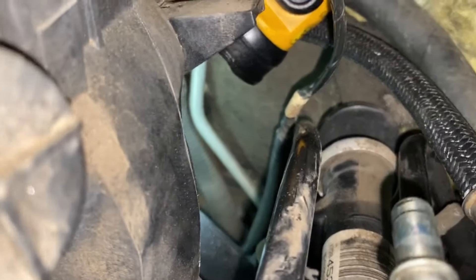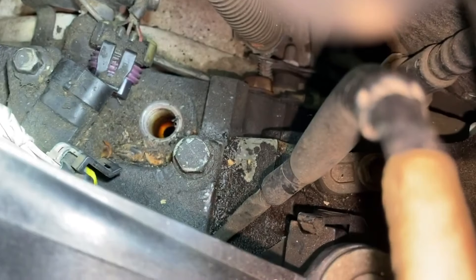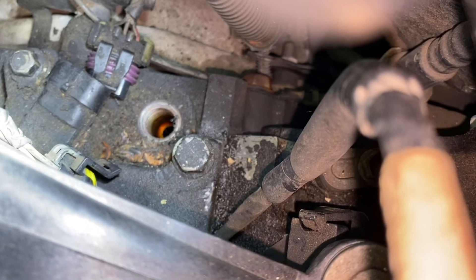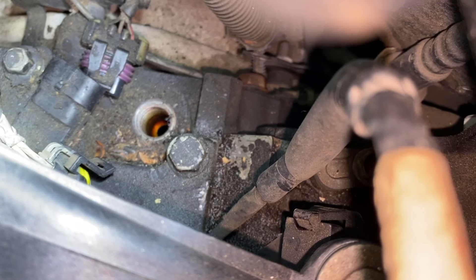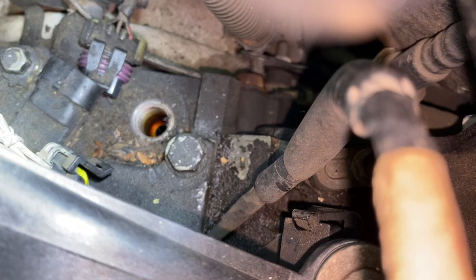One other thing I need to mention before I forget: it's probably just this year model and where they put that connector. You see that connector right down there that's disconnected? Right on the other side of it is a 10 millimeter bolt holding that in place — it was angled just to where I couldn't get my socket over the oil pressure sensor. I took my 10 millimeter swivel socket and loosened that, which allowed me to turn it just enough to get my socket on there. That may save you some time and aggravation.